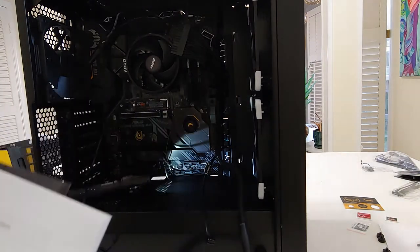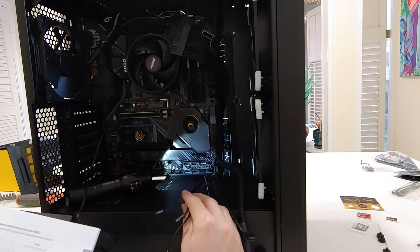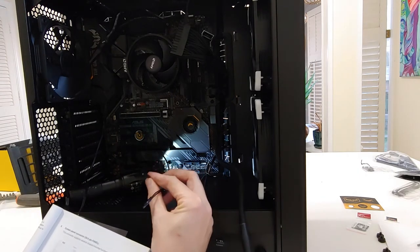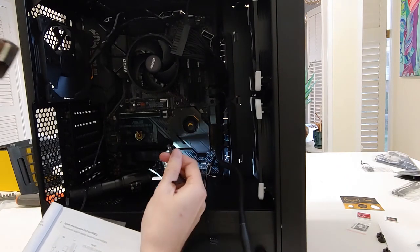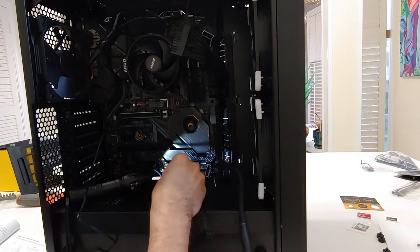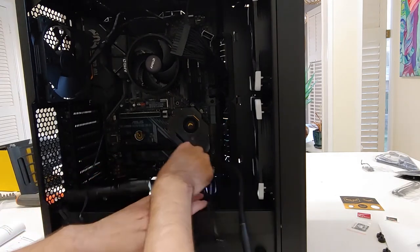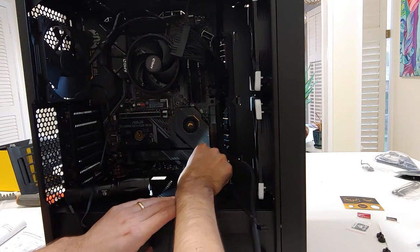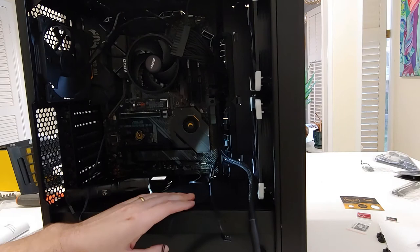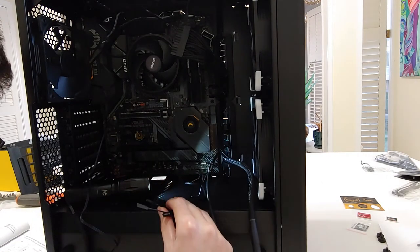Using the booklet, like I mentioned, we'll just try to go from left to right. So we're going to look for hard drive LED. Hard drive LED. Positive is the first pin. So we're looking for that tiny little triangle. And with everything getting in the way, this guy is going in. There we go. One down. All right. What else have we got here?